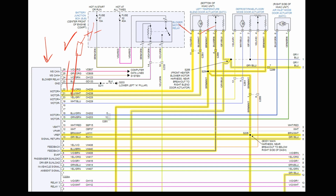So that's one way. There's another way that you could do this, and that would be with an amp clamp and measuring current flow. In this case, I can just pick either of the wires, put that to my lab scope, and then look for current flow as I'm going hot and cold on the dash. I want to see pulses of current. If you see that in both directions, you'll see a positive amperage, and then you'll see a negative amperage.